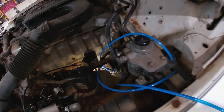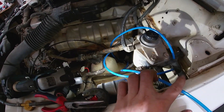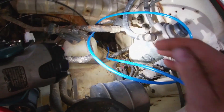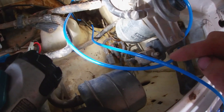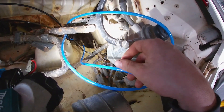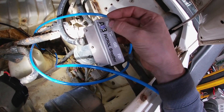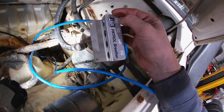Up in the engine bay now - there's a lot going on but pay attention to these blue lines. This one is my front diff, this one is my rear diff, and this one is the gearbox and transfer. I traced the original rubber line - it went into the inner guard through a metal hose just below here - but I've decided to plug in the blue line to match the rest and hook it up to our little station that comes in the kit. The station is labelled RD, TC, GB, and FD - rear diff, transfer case, gearbox, and front diff.